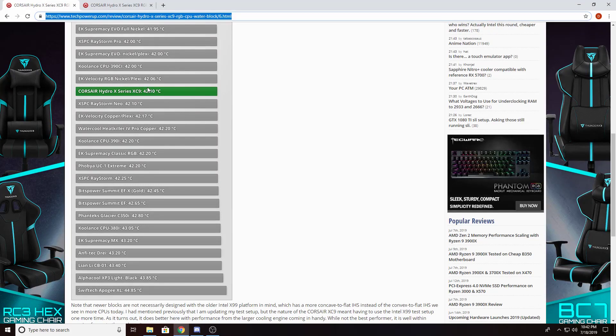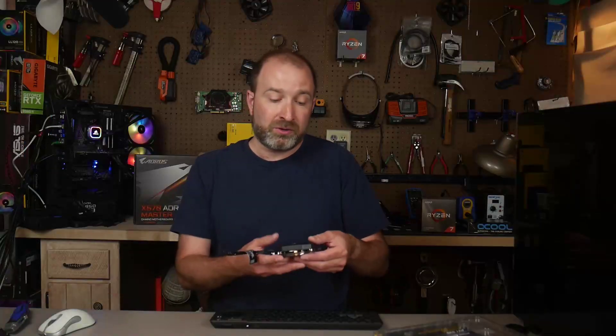I will call this a review — some people call it an overview. When it comes to custom water cooling loops, the CPU block is generally similar to a lot of the other parts, and it tends to be more about aesthetics. You get your performance through better radiators and fan curves, and it's also all about sound. Water cooling can help you reduce the noise level of your system. Just by adding more radiators, it's not necessarily going to make your system run cooler, but you can run your fans at lower speeds so they won't be as loud.